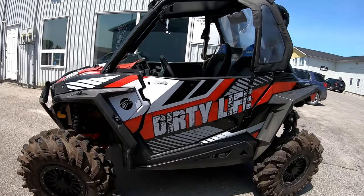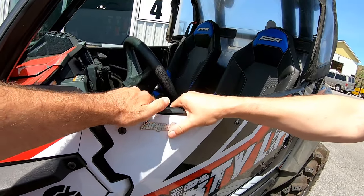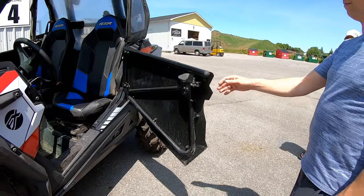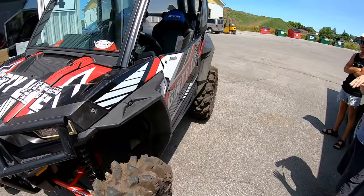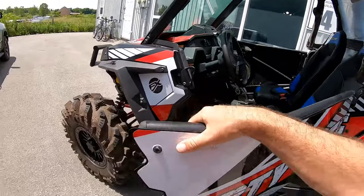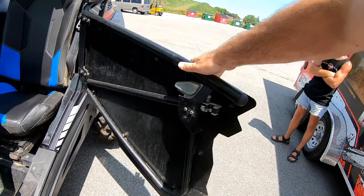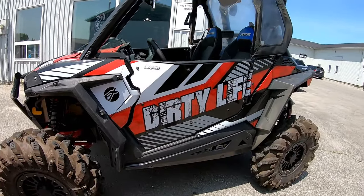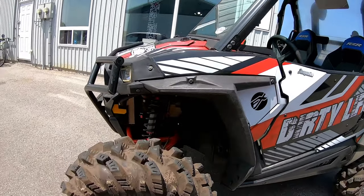This year because we're doing the wrap, we went to the Dragon Fire doors because they're flat so it made the wrap easier. It's a whole different door — aluminum skin. It's a lot nicer door and a lot nicer setup. I never really liked the look of aluminum doors before, but after having them on they sit up a little bit higher and protect you more from rocks. You reuse the Polaris latch mechanism mounted to a different point — I actually like it, it's beefy. Better position and better closure than what you're getting on the X3.